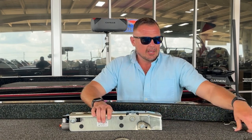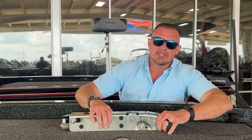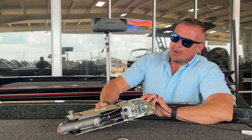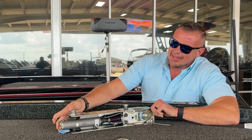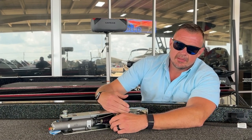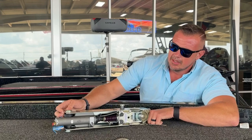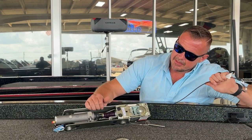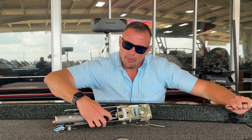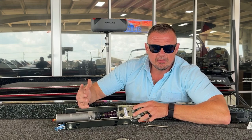This standard two-inch ball, emergency pull pin, and your solenoid back here with your surge system. The way this surge system works — it sits in the collar of your trailer — is when we hit our brakes, this system slides and compresses, which sends fluid through the line, activates your brakes, and applies pressure to assist in stopping. The emergency brake: if this pulls, it's attached to a little pulley under here, and this forcefully compresses this spring.